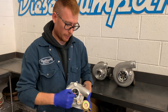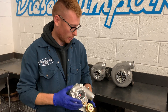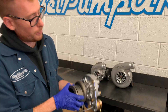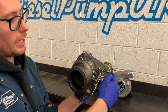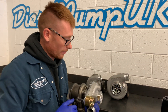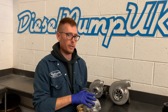It's got a billet compressor wheel which gives us a nice efficiency increase and flow increase. It's also got a custom billet back on the turbo which is really nice — have a look at that. There's a nice CNC actuator bracket, and the turbo is upgraded with a slightly higher performing bearing, though none of these are ball bearing.